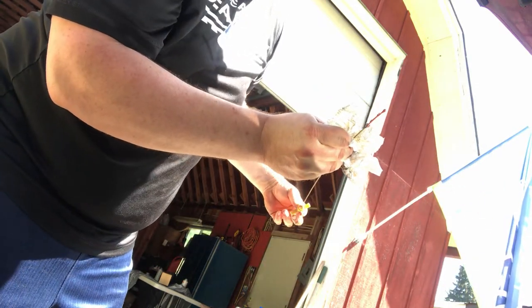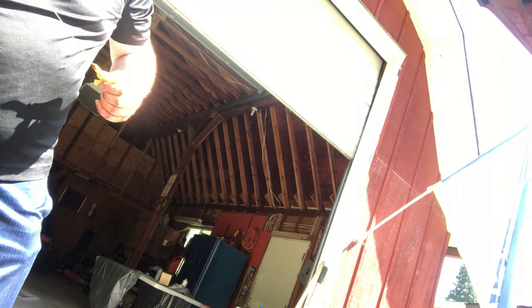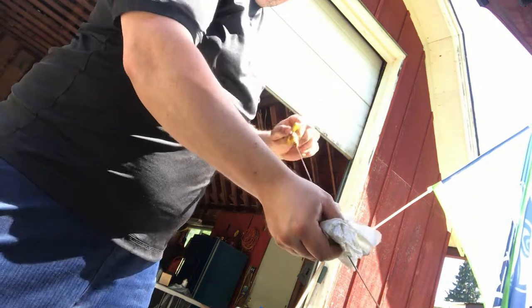I don't have to drain any oil with my dipstick. Oh shit, you see that? It's almost half. Really? That's probably how much went into your filter. All right, so just add a little bit more? Yep. Not a lot more. Probably about half a quart. Okay.